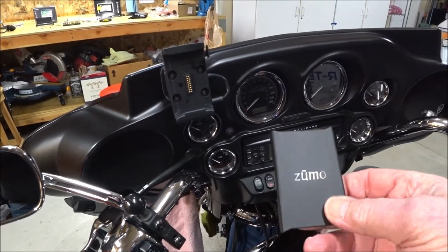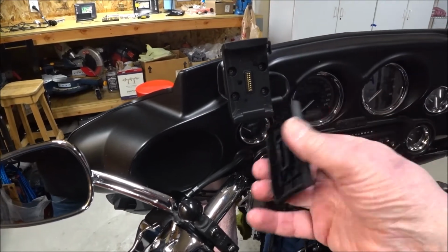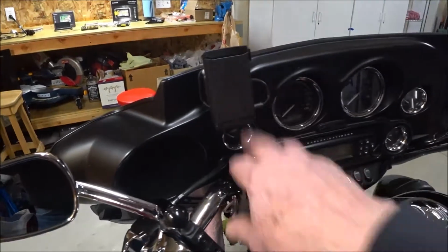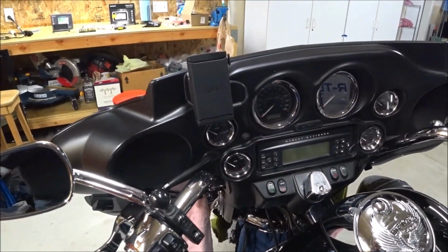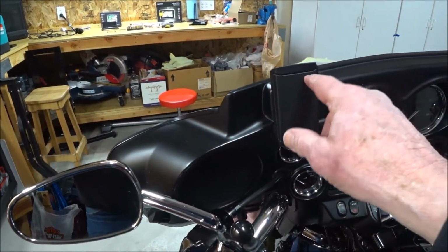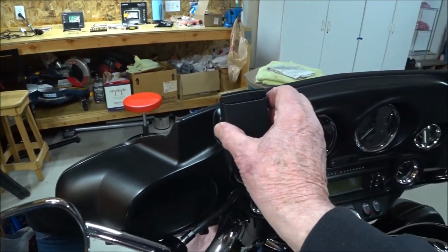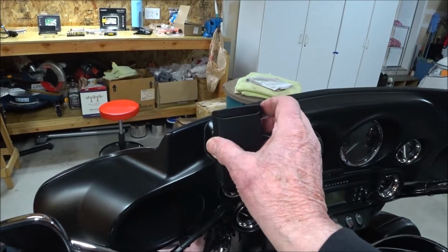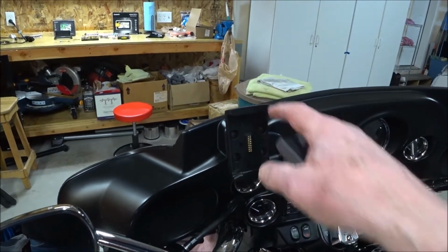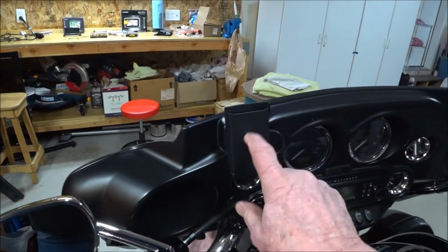The kit includes a cover plate that has a rubber gasket here on the back that protects your connections there. So when you're not riding around or needing your GPS, you've got this to cover it up. One thing you want to make sure of, whether you have a cover on it or the GPS, is that this little rise in the spring clamp there needs to be completely down, like you see it right there. Otherwise, your GPS or cover will come off.